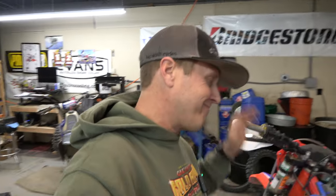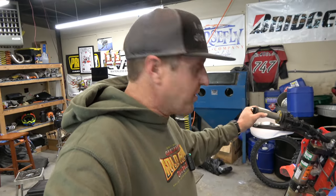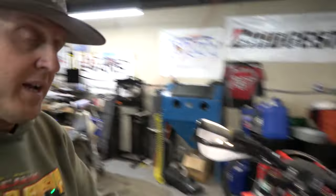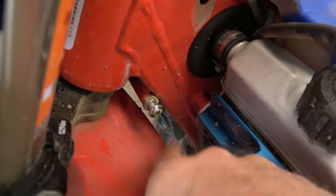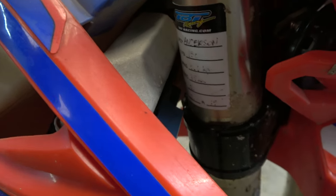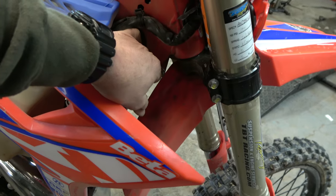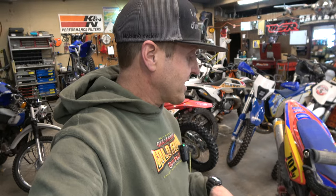which I'm really not even considering a fault because it doesn't affect the way it runs or works - the one real fault I could find is the steering radius. It's not a big deal when you're riding normal trails, but if you get into really tight stuff, or just pushing it around the shop, it's pretty annoying. Under normal conditions you have to run the stops out this far so the fork doesn't hit the top of the radiator. So the plan is: take the steering stops out, pull it back, see where it hits, take a ball peen hammer to it, clearance the radiators, and see if we can get a better turning radius. Join us - here we go.